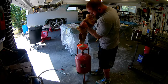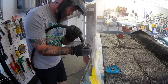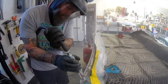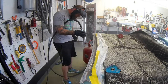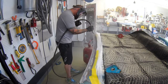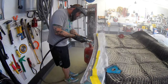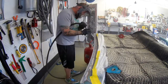We're going to skip on over to some blasting — I'll leave it slow for a little bit and then crank it up. You can see the plastic, and I also took a moving blanket and laid it on top with some welding magnets, trying to keep as much of the glass particles as humanly possible out of the inside of the panel. It's not going to be perfect and you're going to have some work to do — you can see the blast media all over the floor. That's part of the pain in the ass about doing it in your garage. But the good part is you get to reuse it. You can do this outside, but I do have neighbors and I don't want to just start spraying glass around everywhere.